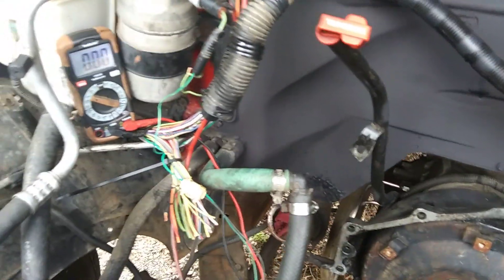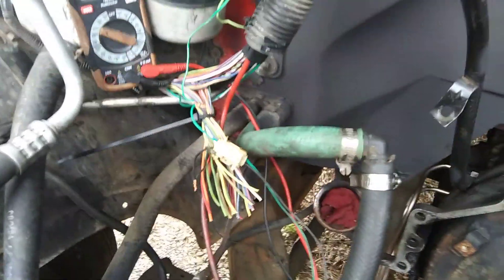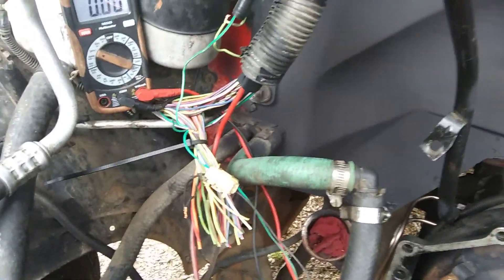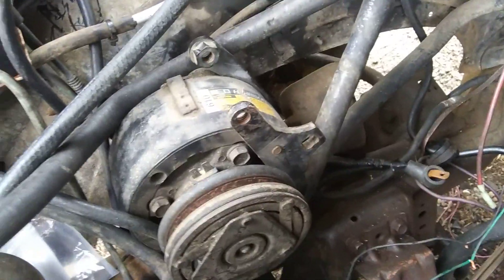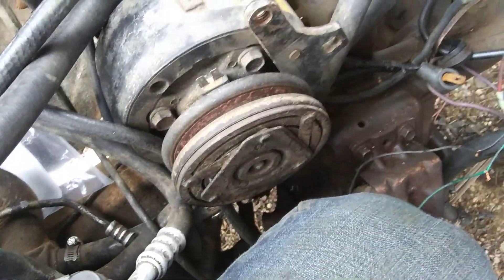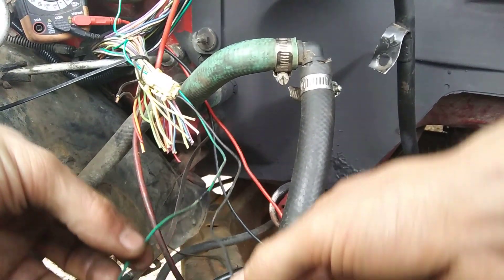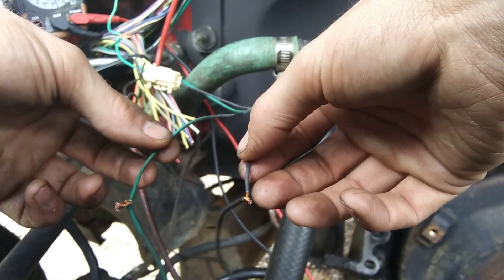Right now inside the truck the key is turned and the AC button is clicked. When the AC button is off, you shouldn't get power to any of the switches, plugs, or wires — it should all be off. You can test that with the voltmeter positive to ground. This here is my AC compressor — these are the two plugs for the clutch. It engages and disengages when I push the button inside the cabin when there's pressure in the system. My plug for it is right here: I've got a green wire and a black wire, one's positive one's negative. I've got a splice right here — that's not going to be how I keep it, I'm going to go back and make it official.